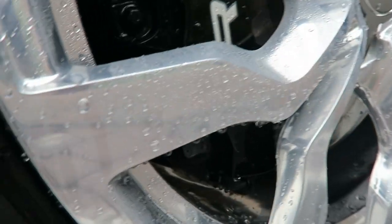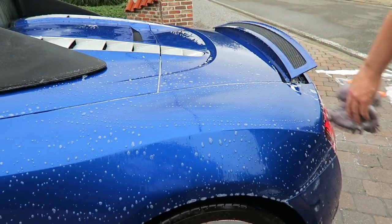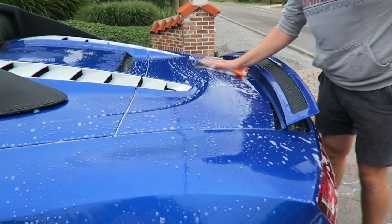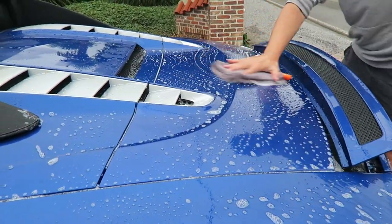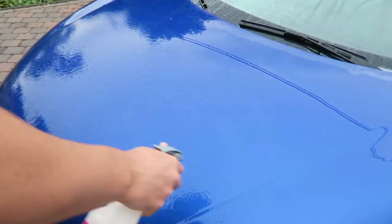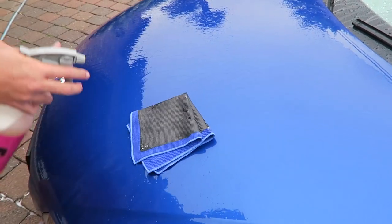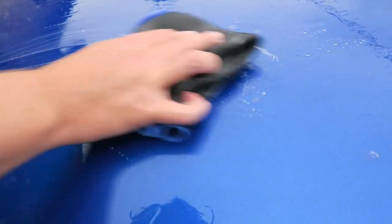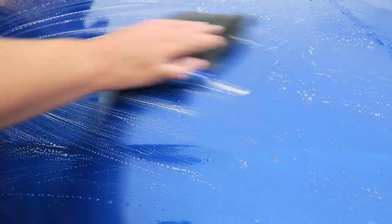All four wheels and tires are now finished, so I went on to contact washing — just with my bucket with Adam's soap in it. You always use two buckets for the washing procedure: one with soap and one with just clean water. You reload your wash mitt with soap, wash the car, then dunk it in the bucket with no soap so all the dirt goes into that bucket, then reload in the soap again. In the end the bucket with clean water has all dirty water, and your soap bucket has pretty clean water — that's what's going into your wash mitt, so you have less chance of scratching the vehicle.